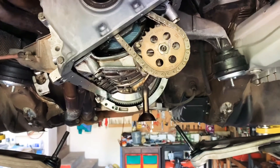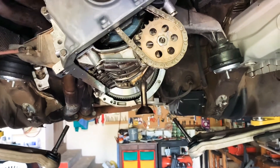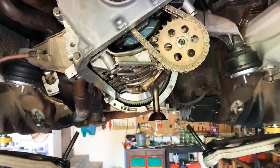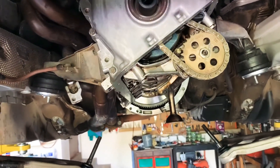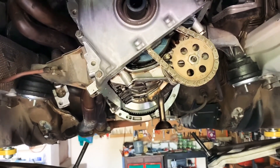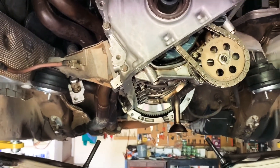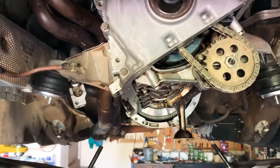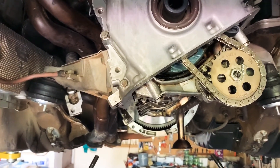Under race conditions you're probably looking at the track and not at your instruments, and you end up with a piece of scrap in the front of your car. There's speculation as to what causes this, but it's safe to conclude it's related to a resonant frequency of vibration particular to this motor, only occurring at very high RPM — probably around six and a half thousand RPM and up. Under normal daily driving you won't spend long enough at the red line to invoke these issues, but for a car tuned for the track and working hard at the red line, this is a very common failure point.